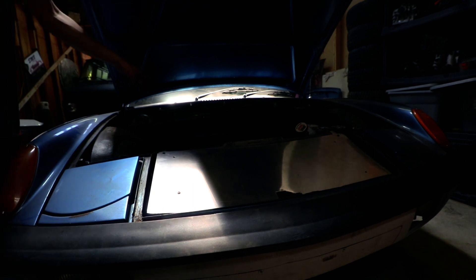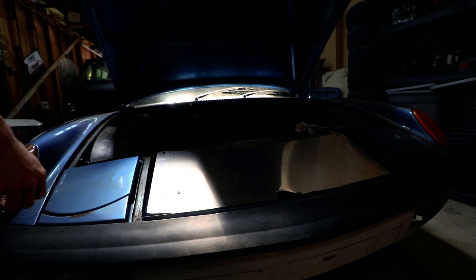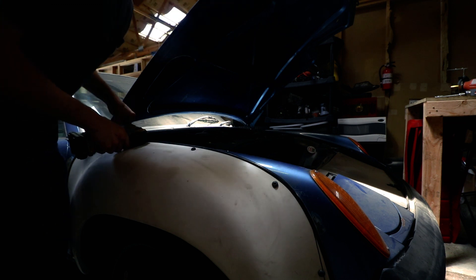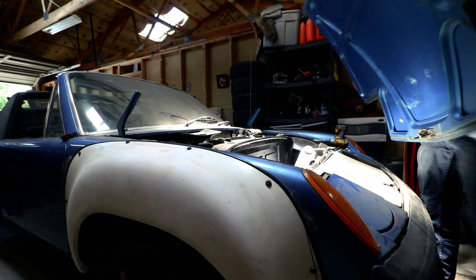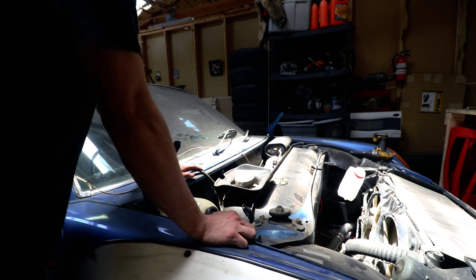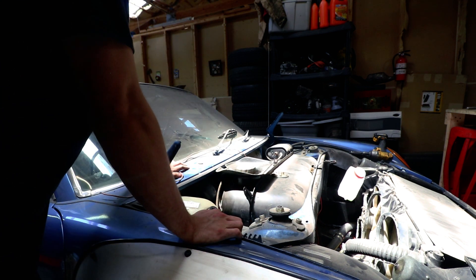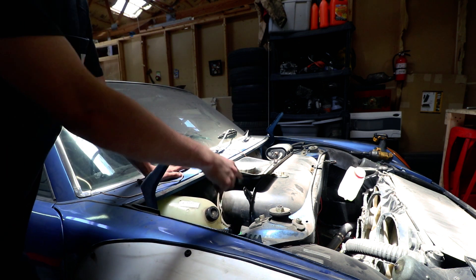The fuel tank on this car is right here next to the front trunk. I'm just gonna yank the hood off real quick because I don't know if I can actually get it out without the hood off, and so that you guys can actually see what's going on. The hood definitely needs to come off because I just dropped the first bolt in there. From what I can tell, there's nothing actually holding the tank in. The previous owner just decided it didn't need to be tied down — it's just loose in here. I'm gonna try to pull it out and see if the fuel lines on the bottom have enough length to disconnect once it's out, otherwise I'll have to crawl under and disconnect them from the bottom.